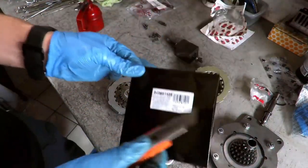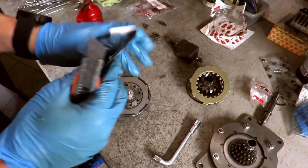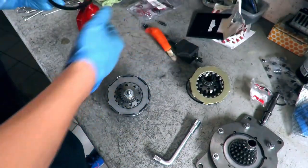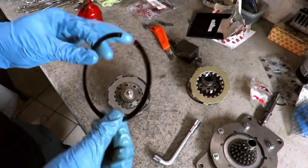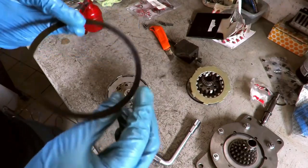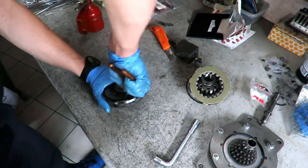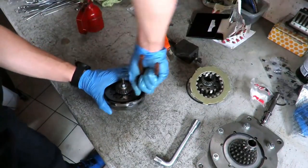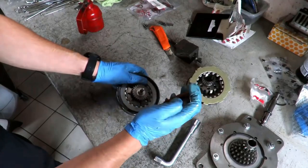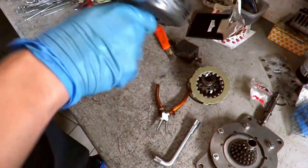Very important, because when these hard springs are used, a reinforced ring must also be used, so as not to risk that the standard one may then skip. This one here is produced by BGM. Here, the old way. Now, I'll center it a little. The ring is in place. Now, we release it.